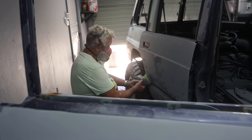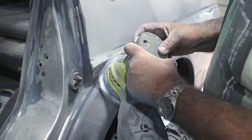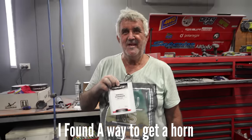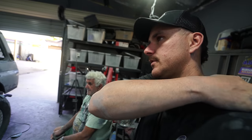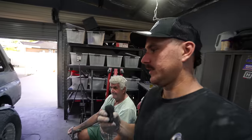If the car had not been painted previously, this process would be quite quick — sand out the imperfections, scuff the original paint and you're ready for high build. But this acrylic paint all has to go. We figured we'd have it done in a few hours with what we've done off camera, but nine hours later and we are still not even close. Everything's done except for the roof. The door jams have taken so long — I've been doing them by hand. The roof is three quarters done. Dad's also gone ahead and finished sanding off every bit of acrylic. Still probably a full day sanding tomorrow. We haven't literally stopped — had lunch and that's it.